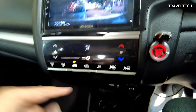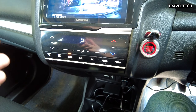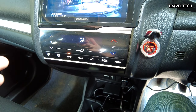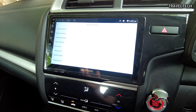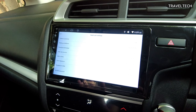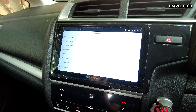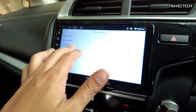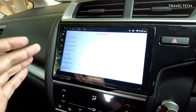Right now the parking monitoring battery is being charged and it takes about two hours to charge completely. Once the car is parked, the parking monitoring system will turn on automatically. If you have turned on time-lapse photography it will use more power and the battery pack will last about two to three hours depending on usage. If you only use parking surveillance — which records events or collisions — it will last upwards of six to seven hours. To save battery, turn off time-lapse photography and keep only parking surveillance enabled.